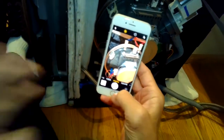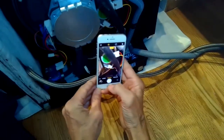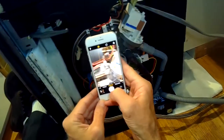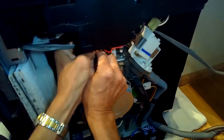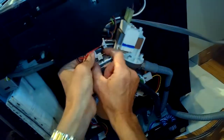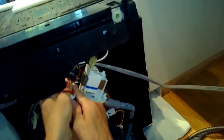I'm taking pictures of how all the wires go onto all the components on the bottom of the sump, because I'm going to be removing all these pieces and putting them on a new sump. The little seal that leaks onto the circulation pump is not one you can easily replace, so LG wants you to actually replace the whole plastic sump itself, which comes with a new seal.